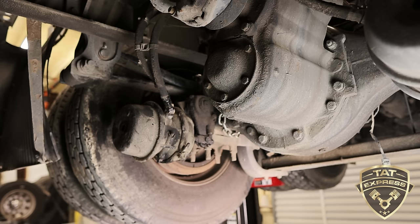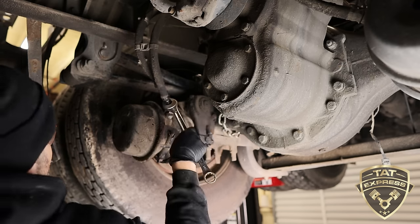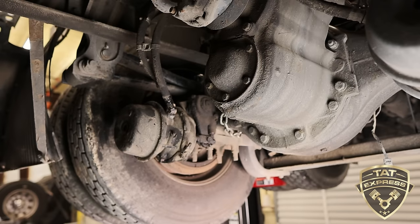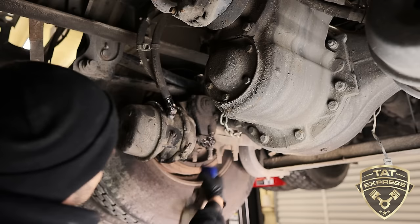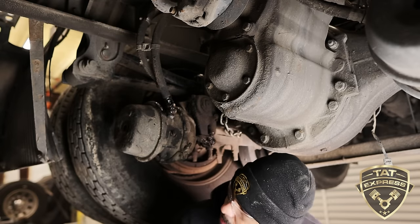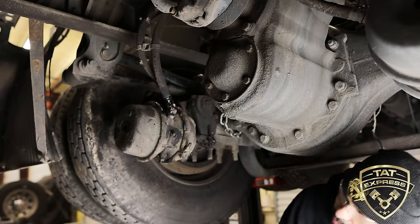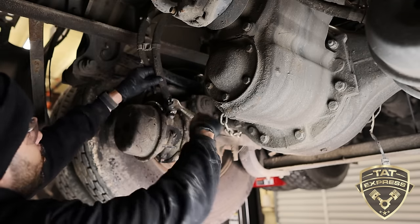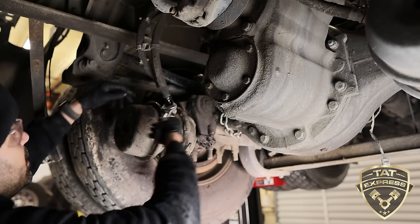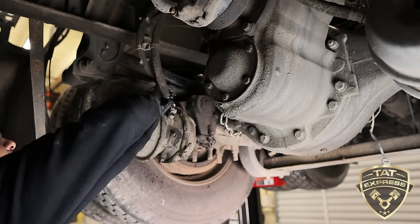So like I said, first thing we're gonna do is remove the hoses. If these hoses don't come off pretty easily, we use WD-40, and get the cotter pins. There's two nuts holding this brake chamber on the back side of the bracket. I'll give you a view of that later. That's what's actually holding that brake chamber on. So take note where these lines are going. You want to put them in the same position. Do not get them mixed up. It will not work correctly.